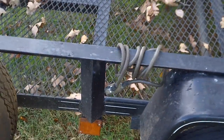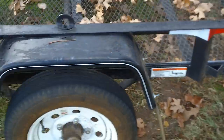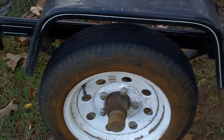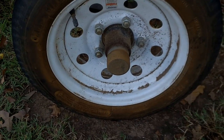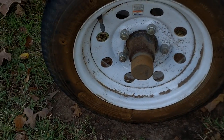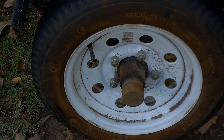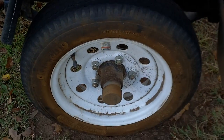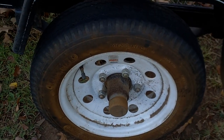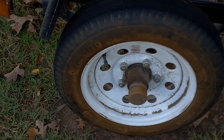You can see right here there's a little amber lens — amber always goes in front of the wheel and the red light goes behind it. In the wheel itself I've got the greasers mounted right there. Once you grease them up, about once a year you need a good shot in there — that's about all you need, and they really make them live long. Trailer tires — you need to use them specifically rated for the heat and the load; they run between 55 to 60 PSI.